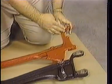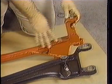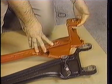All right, let's do a direct comparison between the Rancho beam and the stock Ford beam. As you can see here, the offset in the ball joint area. That's how we obtained our 3 inches of lowering. What we've done is raise this area 3 inches for where the ball joints locate in.